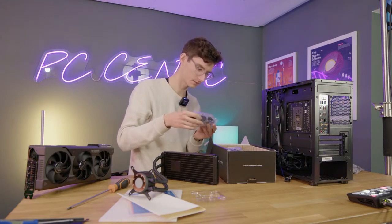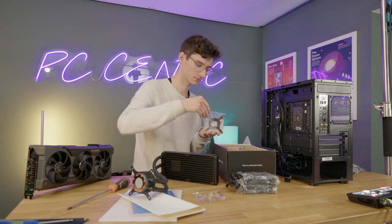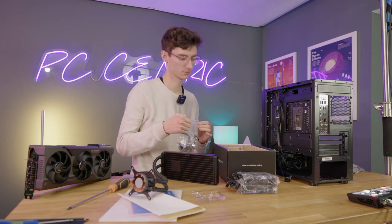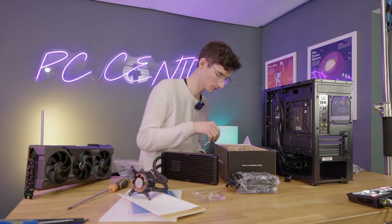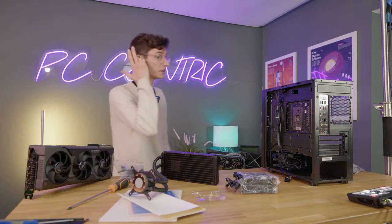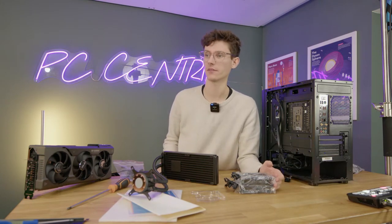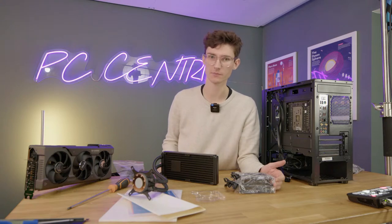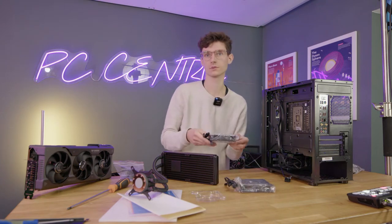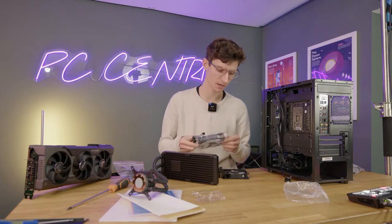A problem, though. Asus ROG Z690 Maximus Hero shows error code 16, and the H100i displays a red triangle on startup. Have you had that before? If your Corsair cooler is flashing red, that usually means the cooler's not working properly, and the error might be that your CPU is hitting 100 degrees. Is it when the USB isn't plugged into the cooler, maybe? The USB-C. Double check everything's plugged in, but it might just be a failure.